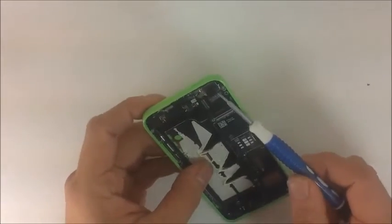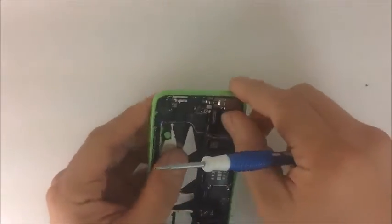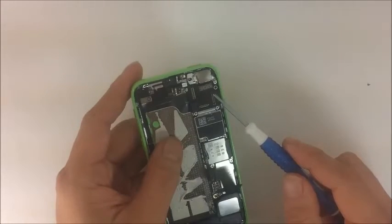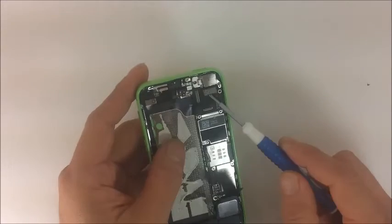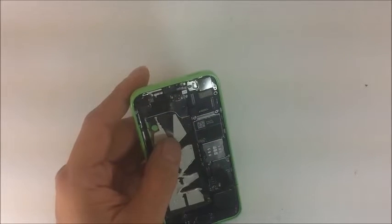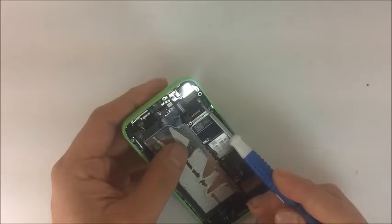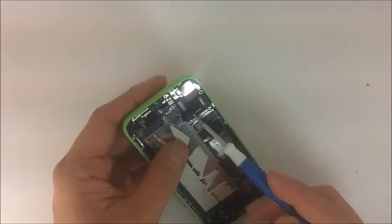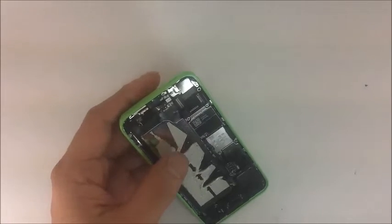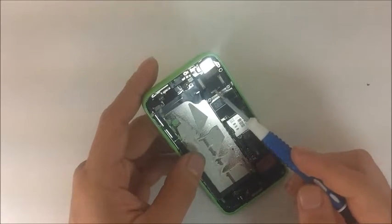Right here is the back camera, which is connected to this flex. I'll remove that so you can see it. If the back camera stops working, it could be an issue with the flex cable or the camera itself — it could be a bad connection, so test all of those. The worst case scenario is if these pads that receive the flex cables get damaged. Then you have to desolder them with a hot air gun, or you can use low melting point solder and cover the entire board except that area.